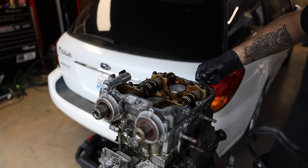I was hoping for the best when I got out there, but unfortunately the coolant expansion tank did turn into a water fountain, which is a key sign that the head gaskets failed significantly, because it's shooting all that compression into the cooling system and trying to blow that coolant out of the coolant expansion tank. And it's unfortunate that it did happen. Car was smoking a little bit. Coolant temps were getting up.